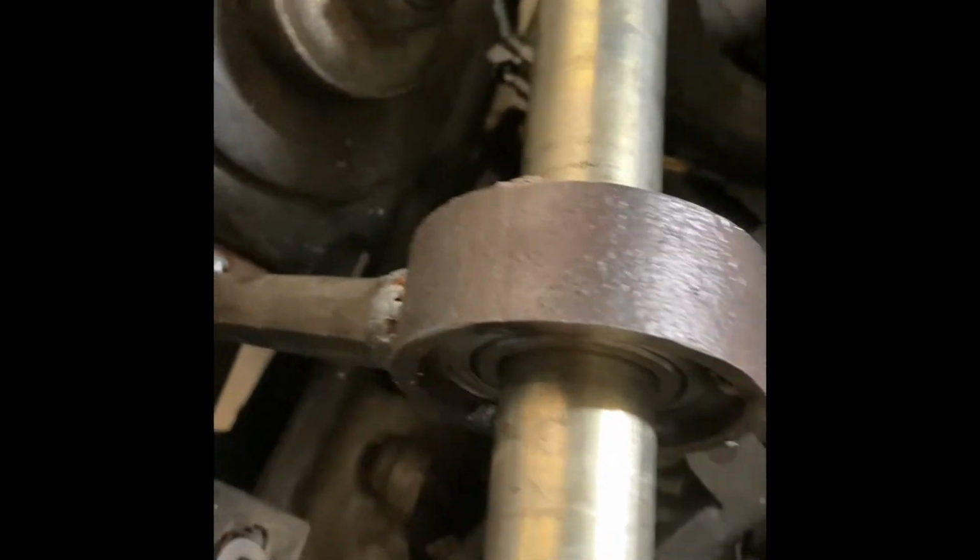Okay, so there she is. Complete steering shaft. All the way through its bearing. I made that to where it would bolt up or bolt loose so that that steering column can come apart if need be. I welded the U-joint in. It's also slotted to where it fits in there and grabs. And then we had to splice it into where the steering column goes into the firewall.